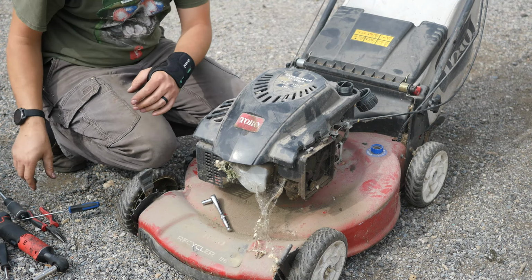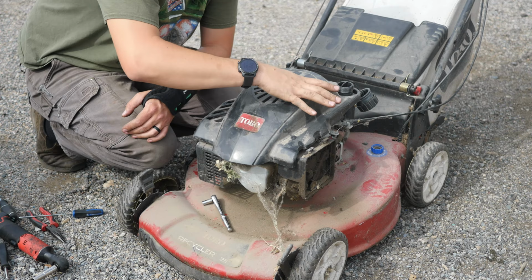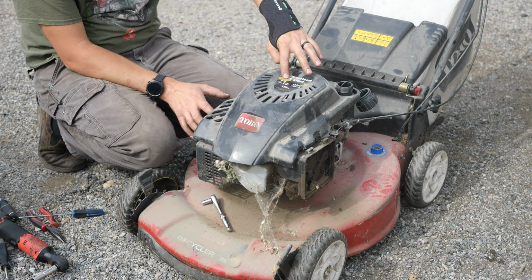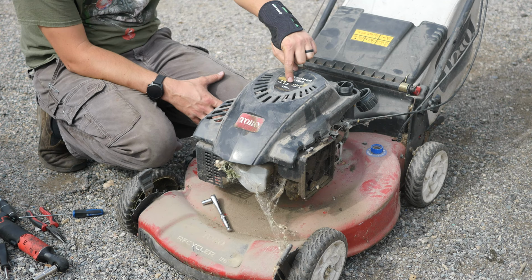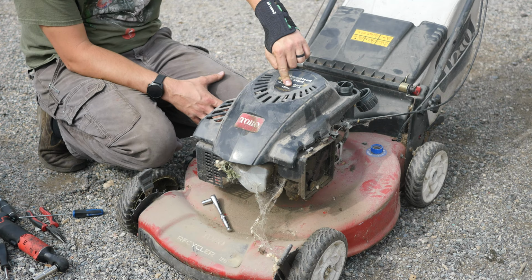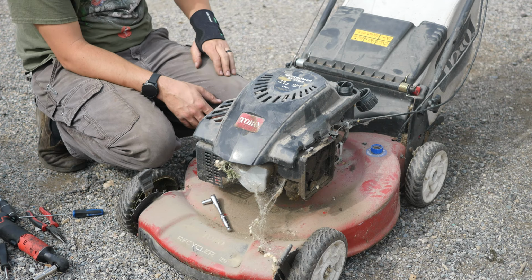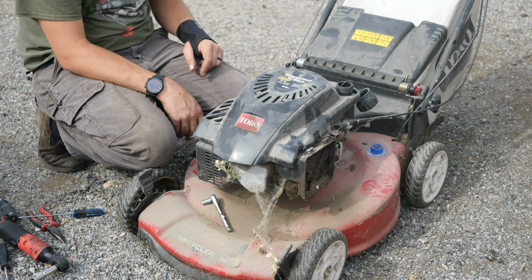Again, this is something that they've been doing that's real tricky. And they've been doing it on like all new engines, everything. It says 7.4. This used to be a horsepower rating. And I think they've gotten everybody used to this being a horsepower rating, but it's actually foot-pounds gross torque. It's only a 159cc engine. This is probably a 3-horse or 4-horsepower engine. It would be in the 200s, would be like the 5 to 6 horsepower, like 2 to 250 or whatever. It's just interesting that they've done that on all these engines. They've downsized them and told no one.